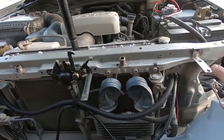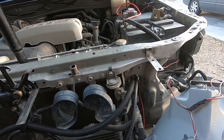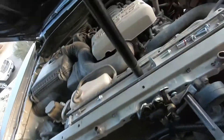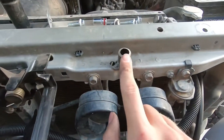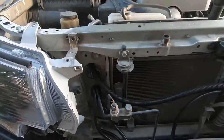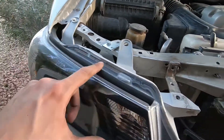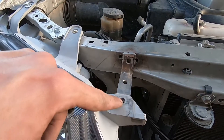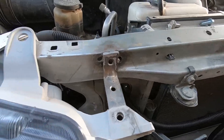To continue on with the front end — the grill — I have this little bracket that's utilized to hold up the headlights as well as the grill. It gives it a little more stability. The important thing I did over what most guys do is use a one-inch spacer to raise up the grill one inch so it sits flush with the hood. I did it on both sides. So this is kind of what it looks like all mounted up. This part just rests right on here. I also had to drill this hole out right here, and there's a bolt that goes through that and attaches both the grill and the headlights.